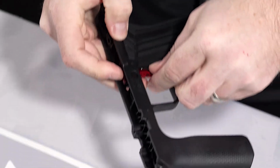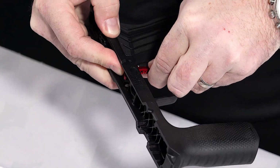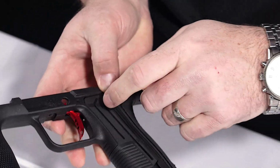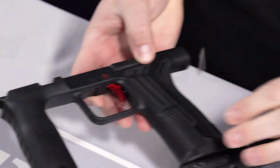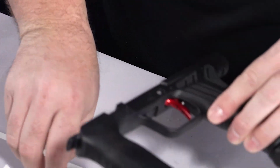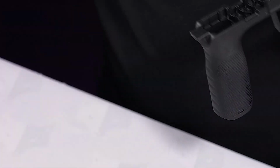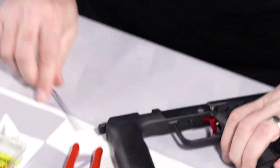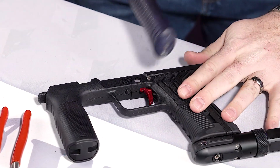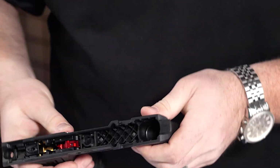It's lined up. There we go. So when you go to put it in, essentially this rod is going right through the center of the bearing. So make sure the center of the bearing is lined up with that hole. Push it in. And you can either pound it back in or use just a little rubber end of the hammer. Push it until it's flush, and then that kind of sticks out a little bit. Kind of a cool look for you with the skull. So you got that back in.